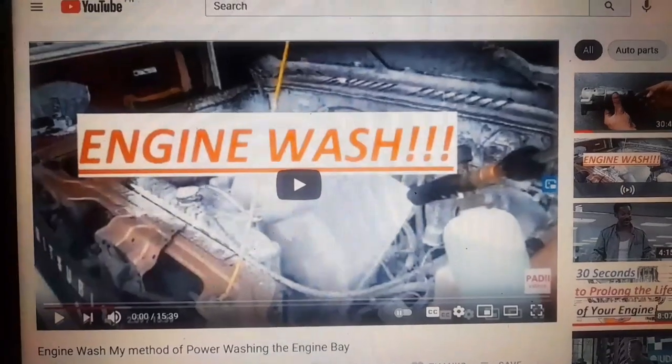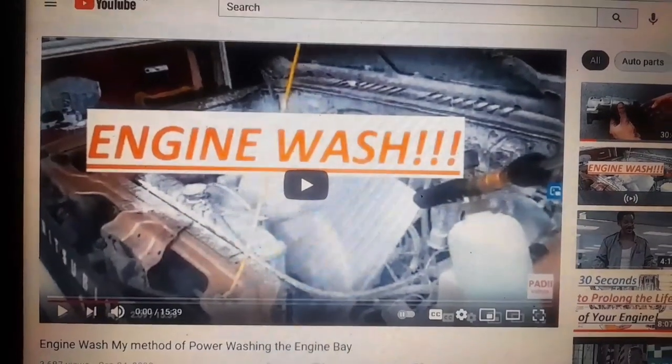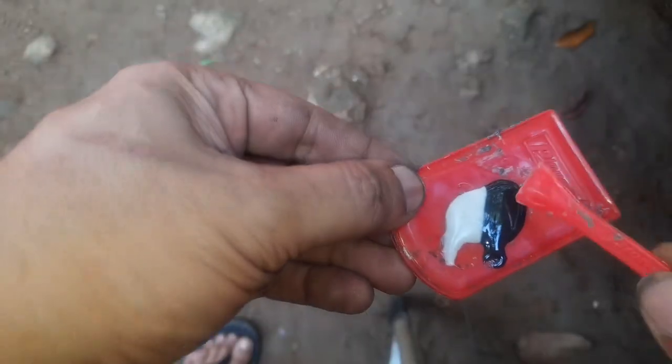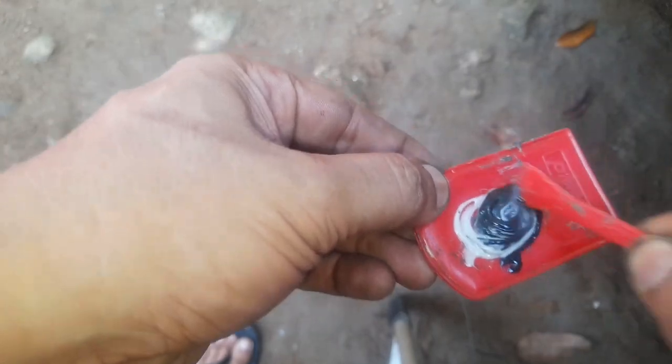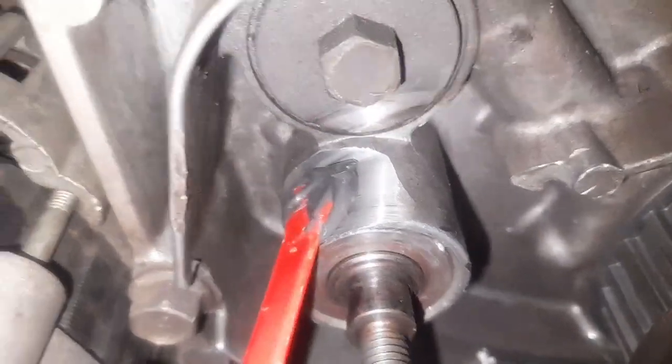Anyway, I'm going to give this a good clean wash just like I did in another video, put everything back again without the silent shaft. It's all clean now. I'll cover the crack with steel epoxy just to prevent the oil from leaking out of there.